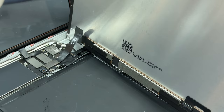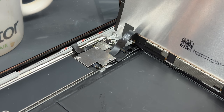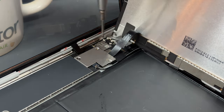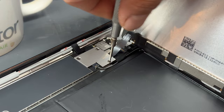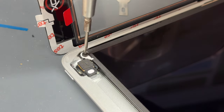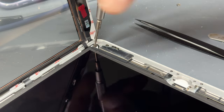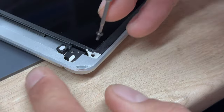You need your dexterity again when reconnecting this — I'm holding it in one hand and connecting it with the other. This is the part where you'll be really grateful for magnetic screwdrivers, because if you're holding the LCD with one hand you don't have another hand free to help guide the screwdriver into the holes. Re-secure the three screws holding down the shield and make sure they're nice and tight. With those secured, pull out the battery isolating pick, re-secure the battery screw, then lay the LCD flat into the chassis, make sure all four corners line up nicely, and begin re-securing those four screws in each corner.